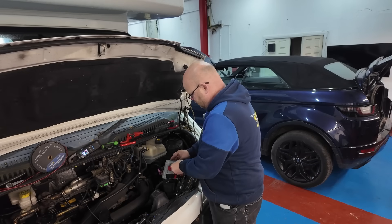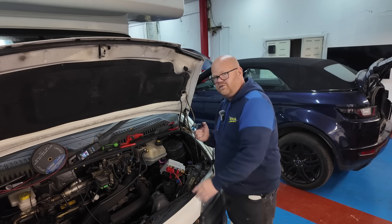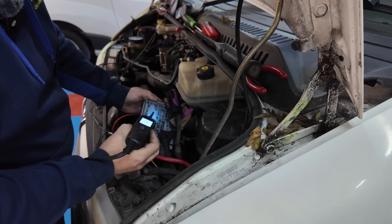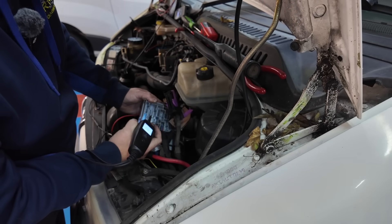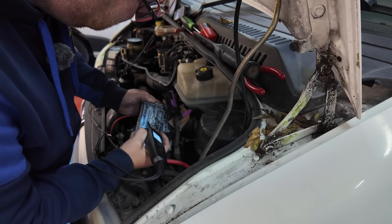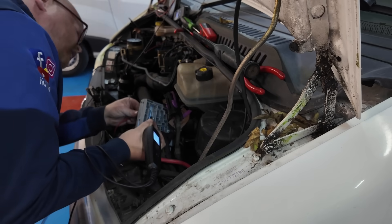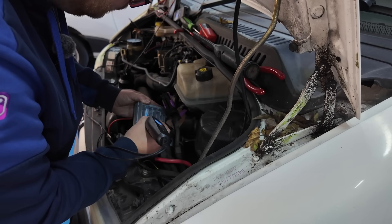Let's have a go. We know it's on that plug. If we get our meter and go underneath to all the terminals - so that's going in. Hopefully we've only got one voltage feed coming out of these pins and then we'll be able to see. I've got it on one volt feed coming from the bulb on that pin. Just to confirm, we hold it onto the pin we know it's on, remove the bulb and that voltage goes. So back in. That is pin one, two, three, four, five, six, seven.